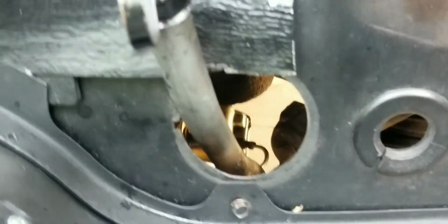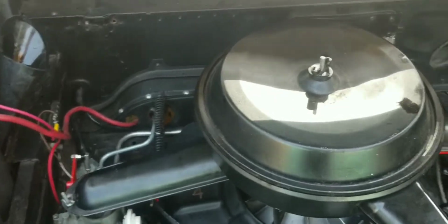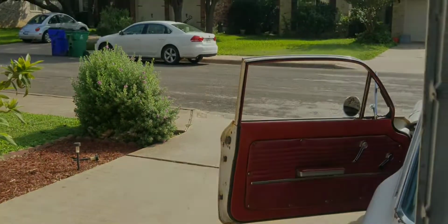And you see, we got our modulator right there. So maybe the fluid was a little too high, swooshed back, got sucked up into that modulator and came through this line and got burnt. Because whenever I rev it by itself, it's not smoking. But I want to test that right now, just drive it.